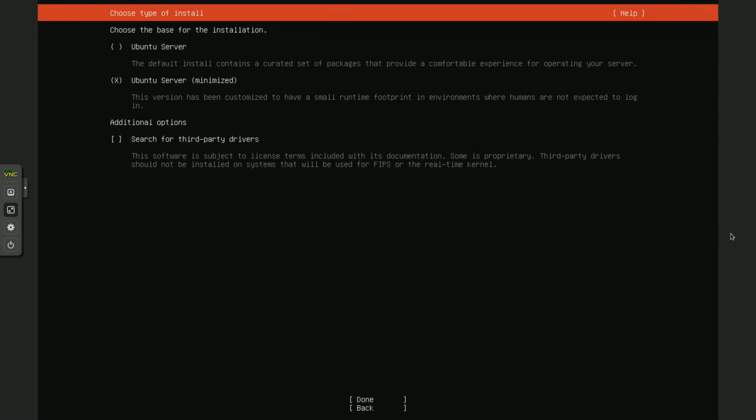I mean, I've got 96 gigs, which sounds like a lot. When you think about it in the grand scheme of things, that means I can only have 90 VMs that are 1 gigabyte RAM apiece, and that's if I don't use ZFS. So now that I'm using ZFS, that number halves. So I can have 45 VMs.